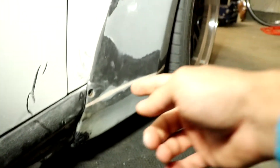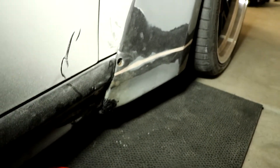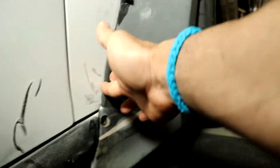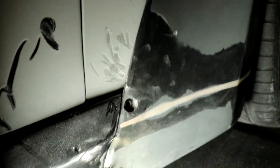Lastly, I did go ahead and cut into this side skirt here, and a little bit on the other sides as well, just so I can give better fitment to this body kit. Now there should be no gap. I cut quite a bit off just so I can have fitment, and no one's going to see it so I don't really care. We're going to fix some of the holes in the car, and some parts I have to screw in - but it won't screw in anymore because I took some of the kit off. So we're going to weld on a nut just so I can screw it on.